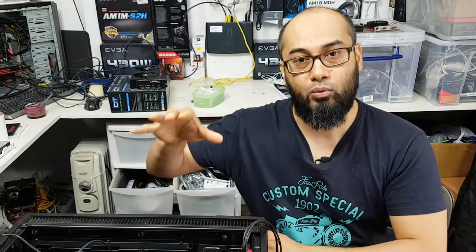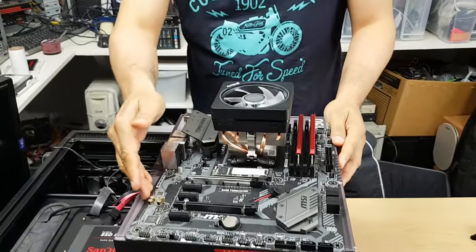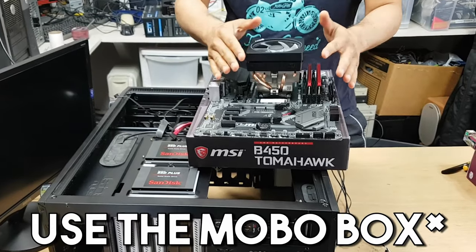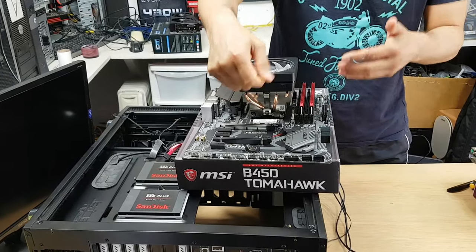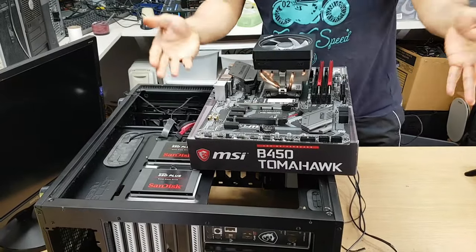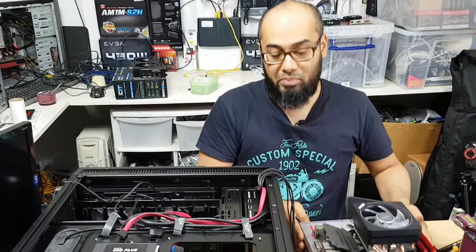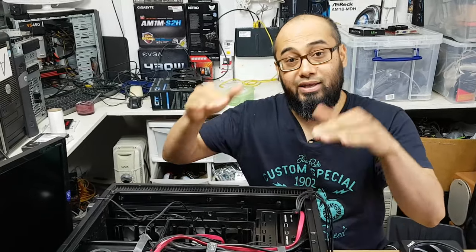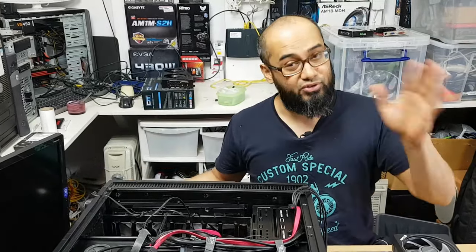There's one extra precaution you could do depending on how far along your build is. If you've connected your power supply to the motherboard and all relevant power cables, you could place the motherboard outside the case on top of the box — making sure it's not making contact with the case — and do a power switch on test. Use the power switch from your case to turn it on while all front panel connectors are connected. This confirms things are working before you put it all inside, which saves you from discovering a problem after the build is complete.